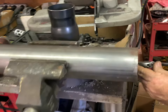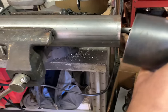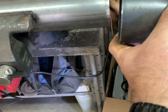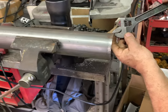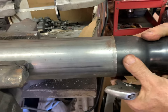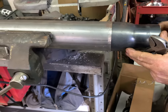What buddy's doing right now is he's rolling just a small lip so we won't have just a direct butt weld. We want this to slip up in there just a little bit to get more strength versus a shoulder-to-shoulder weld. Roll that up just a hair — luckily we have just enough pipe to do both extensions, so this is not going to be really bad at all. That gives a whole lot stronger connection — come back and weld right there and it'll be really strong.